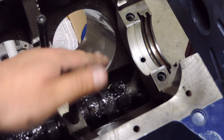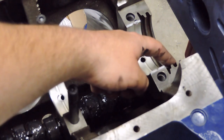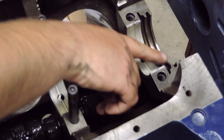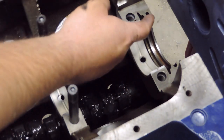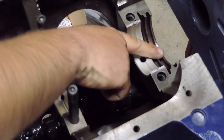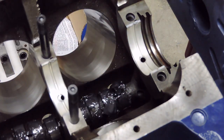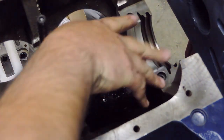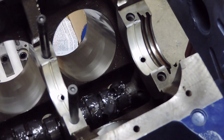So what you need to do is, in the rear main seal groove here, there's a tendency, especially since I had this block line honed, that there's a sharp lip right here. If you run your finger along it, sometimes you'll feel it's kind of a sharp edge. So I went in with a really, really fine knife sharpening stone and just drug it back and forth like this a couple times just to clean it off so it wasn't so sharp, and went in with some brake clean, cleaned off any of the stone dust, cleaned off any of the block material, so it's a nice, clean mating surface. I also went in with some brake clean on these sides of the block here, where the main cap rests onto the block, because I will be putting RTV on there as well to help get a better seal so I don't have any oil leaks.